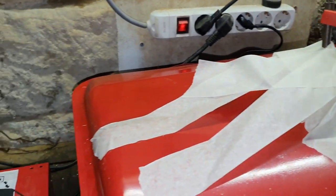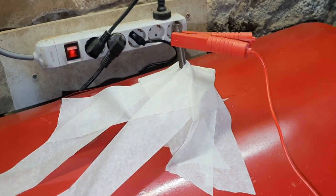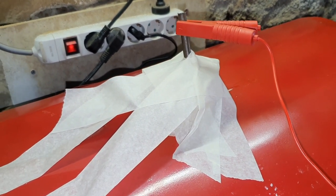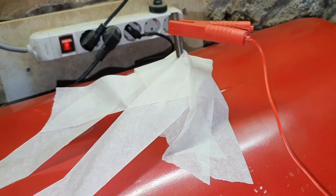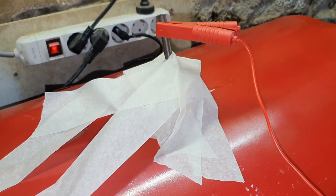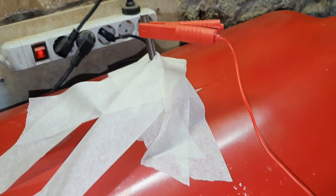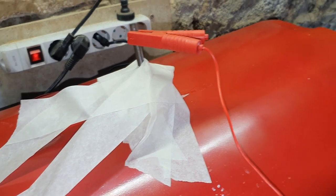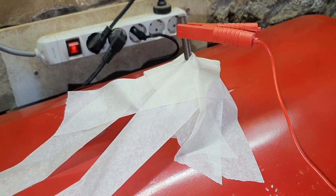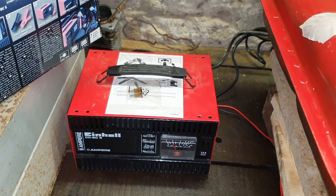To the cap, the anode is taped with some duct tape so it doesn't move. Seems pretty tight. Now it's just a matter of leaving it in place — 24 hours and having a look. After 24 hours, if it's still rusty, we can give it another go: clean off the anode, and add a new solution. You can also filter out the old solution. I'm using the battery charger.